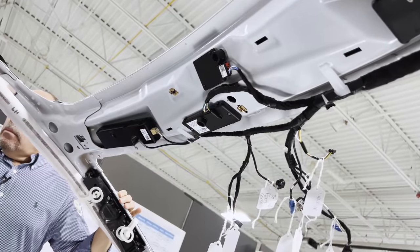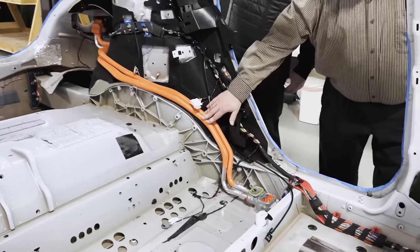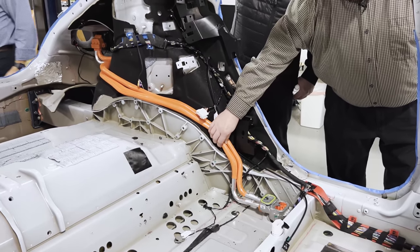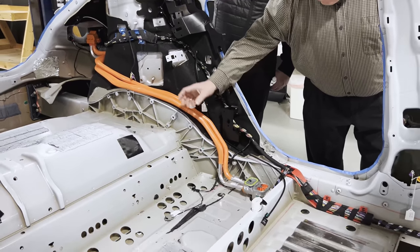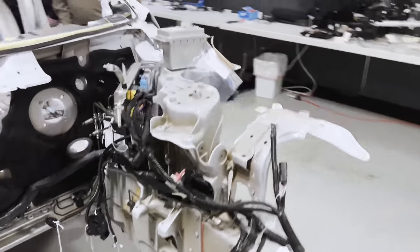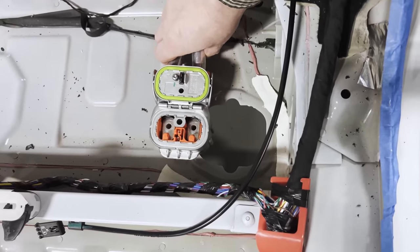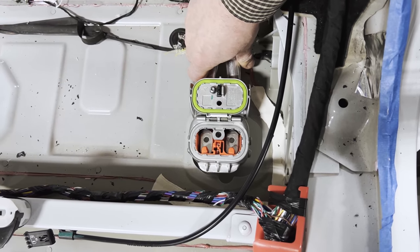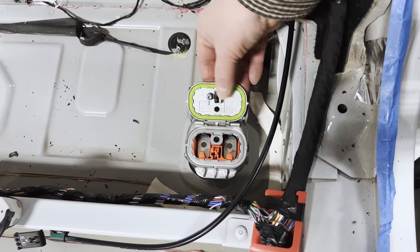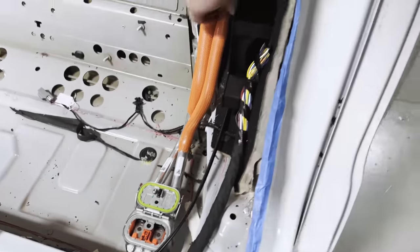Another large carry-over is the high-voltage onboard charging setup. Instead of cabling, they're again using an inner aluminum bar and an outer aluminum tube with an insulator between them as the current conductor — same approach as the Model Y. This goes right through the floor to connect to the battery module responsible for charging. Once the two bolts are down, a shorting bar connects everything, locks it all down, and it's a lot less expensive than traditional cabling.